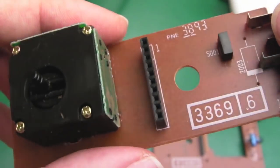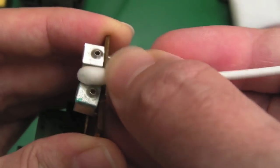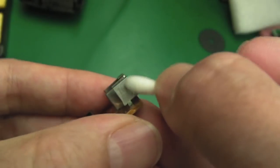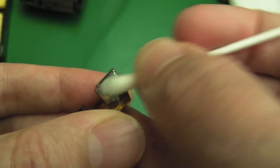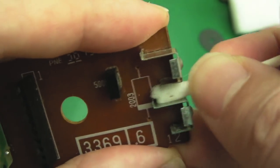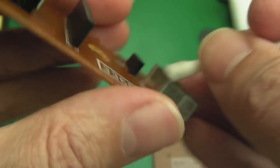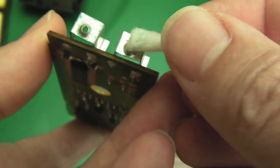Assuming this doesn't get skipped, or I expire and my wife throws it all in the bin. So we'll go over the contacts here with a bit of IPA first of all, then I'm going to get the fiberglass pen onto this. It's just a bit blue there where the alkaline has leaked out the batteries — it could be a lot worse. I'm sure there are examples out there of these where they're really, really bad, and you may need to swap out the connections. It's just two contacts there, so you could find a similar type of connector from another old remote — maybe from an old VCR or something.